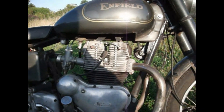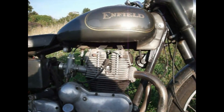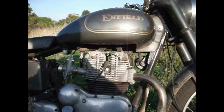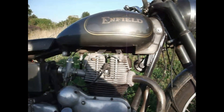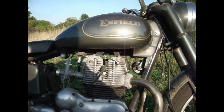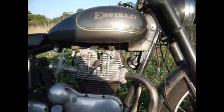But this one's not too powerful because it's been bored out to plus 20, and it's had to have low compression pistons. Because you cannot buy Meteor Minor sport — high compression — pistons in oversizes. There are a few new standard ones kicking around, but you can't buy the oversizes. So if I want to put Meteor Minor sports pistons back in it, I've got to bore the barrels out again and have them re-sleeved back to standard.